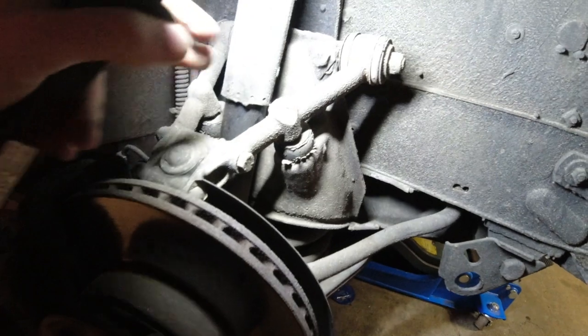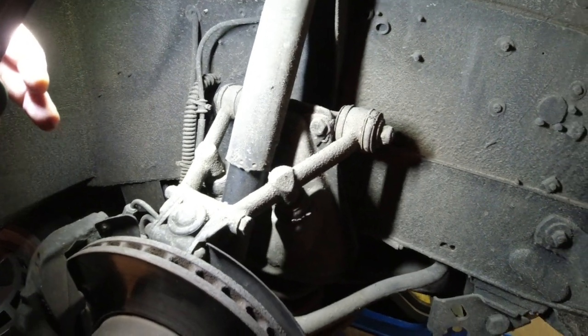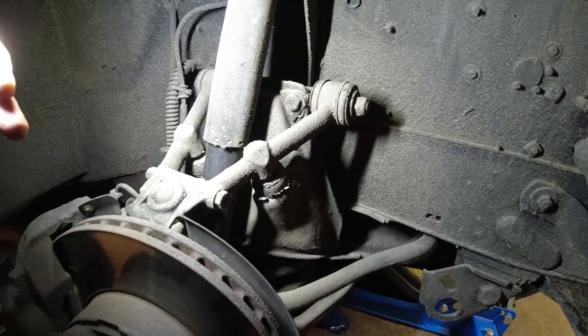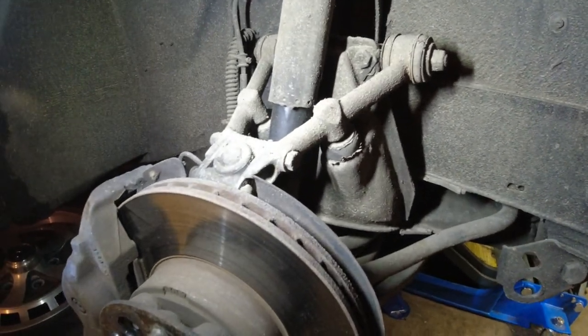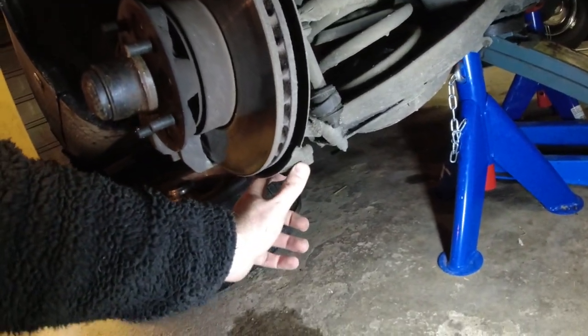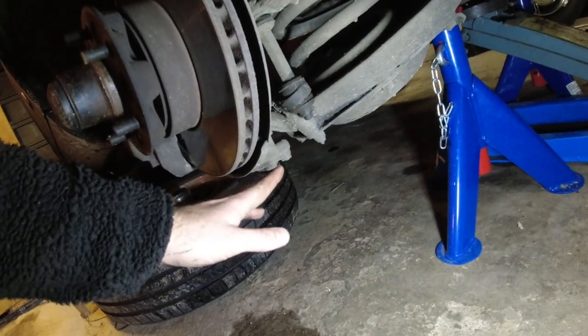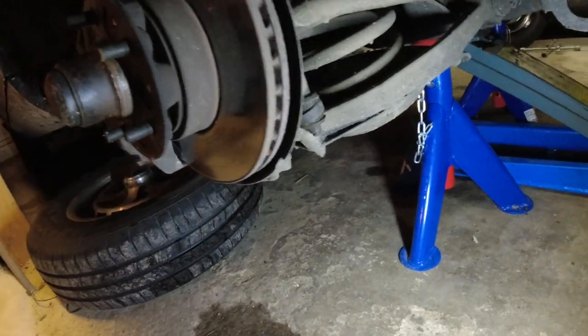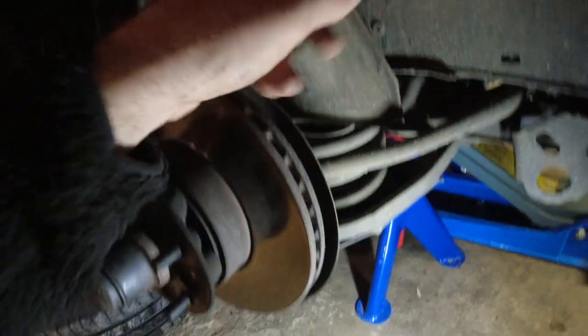Of course, there are other things that wear out. These top bounce pads can crack, but they hardly ever get any play in them. They can look utterly terrible but there's still no play in them. The bump stops can usually just fall away — not that big of a deal, you can easily replace them. If you have a knocking sound when you put the car in gear and you feel like the whole front suspension is knocking, that's usually a top or bottom ball joint, and it's just moving. If it's moving really, really a lot, then of course it could be the main front suspension mounts, but that is really rather uncommon.